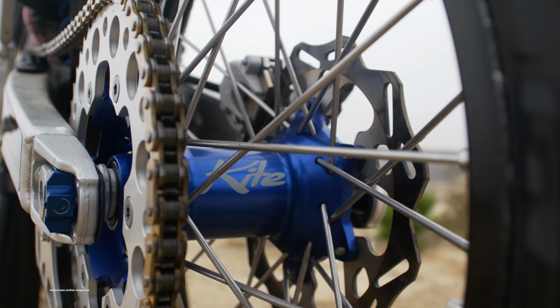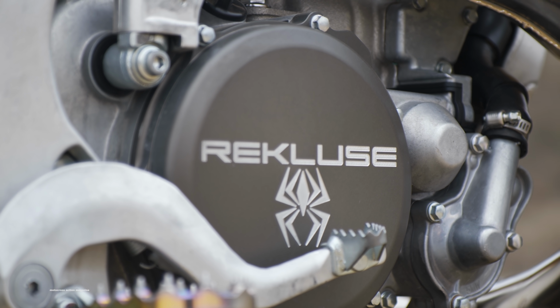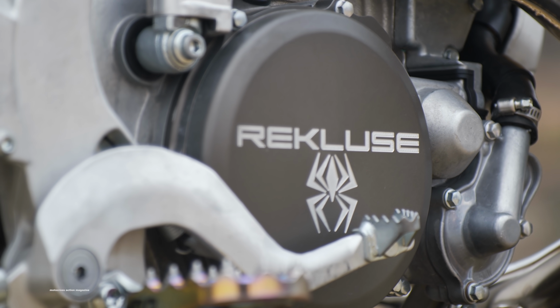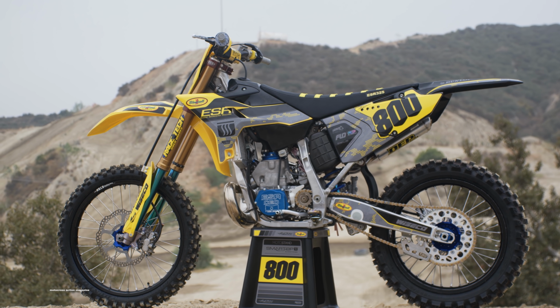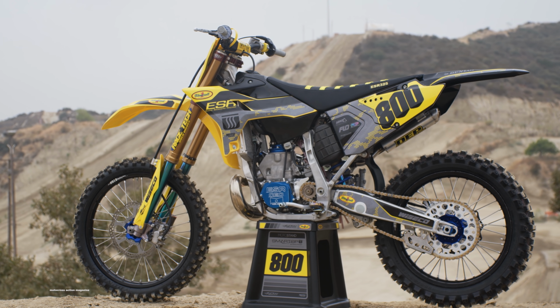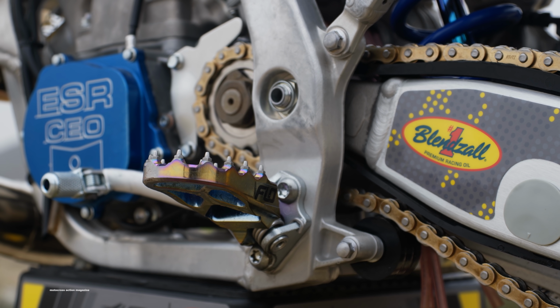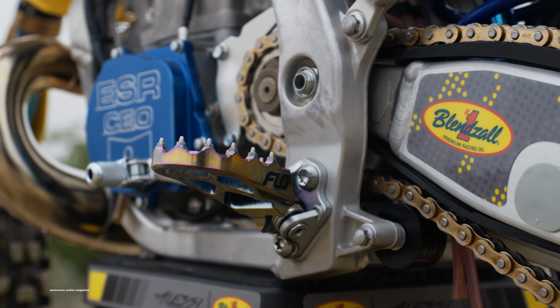Mike said that he puts his pedal high just to keep himself from using it. He said that he wants to ride with as little rear brake as possible, so that it's basically just there in case of emergency. This tactic is understandable on a four-stroke where there's engine braking, but on a freewheeling two-stroke, it seemed a little sketchy. Our test riders did their best to ride with less rear brake for the day, and we already knew this technique would work well, but it was still a challenge to apply moderate pressure without brake sliding into corners.